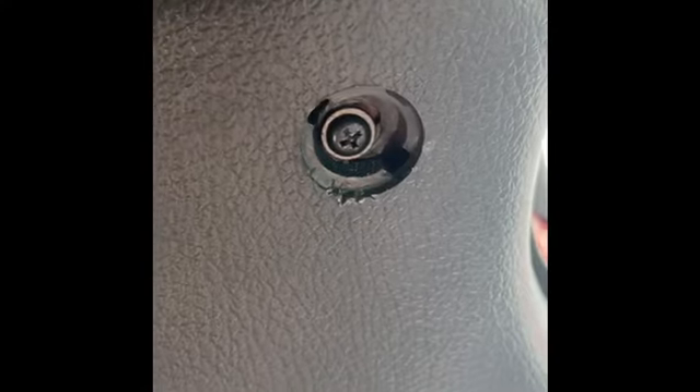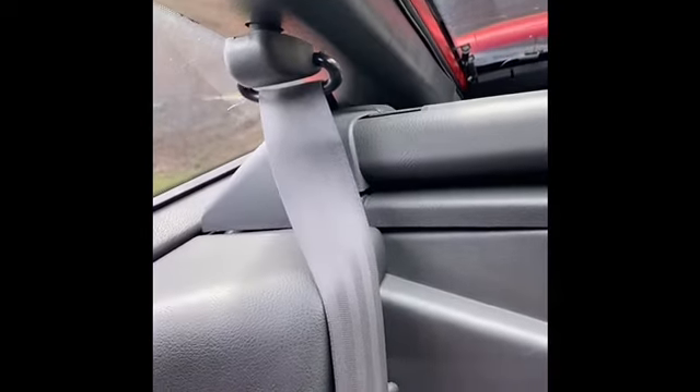This whole panel here should hopefully come off so I can get behind here and take the screws off that are still on there, holding the little clips on the back side where that trim would sit. Get those out, and then place the new right-hand trim piece behind the window back in place. I got that little tab off and there's a little screw in there — take that off and that should be everything holding this panel into place. Not sure if there's a piece down in the back holding it in, but that might be for the speaker cover.